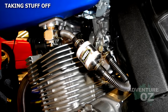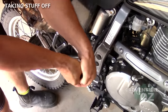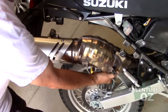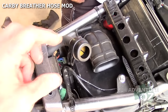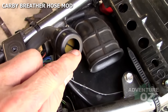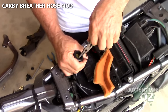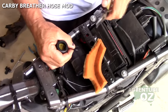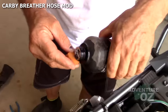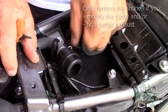This is a critical mod — this is your breather for the vacuum carby. If this gets dirty or blocked, you're going to be wearing your carby out and your bike will stop running. We recommend servicing this every time you service your air filter as well. The beauty of adding extra fine protection is that you never have to service the inside one — you can just pull this out easily.